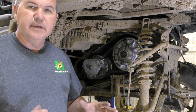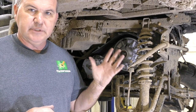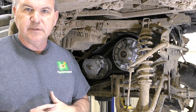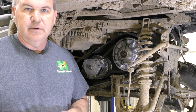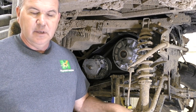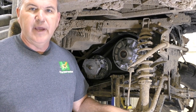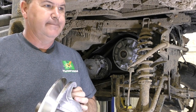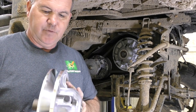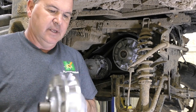So anyway, what this is about is how to install the Dura Clutch system. Dura Clutch has changed their secondary up for the 2016 and newer models that had the square puck style clutch. They did it mostly because that clutch has a low speed noise — anybody who follows Razors or anything else knows these things have a low speed sound radiating from the secondary. So there's a new secondary out by them, and here it is.